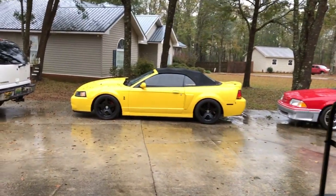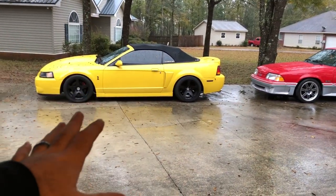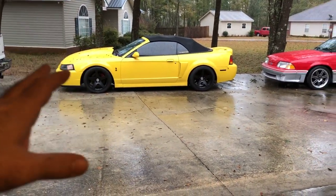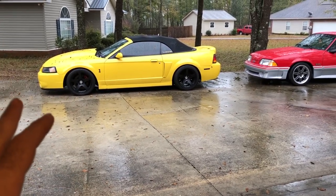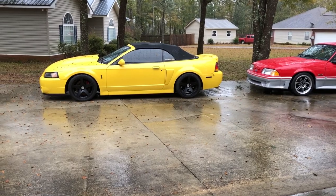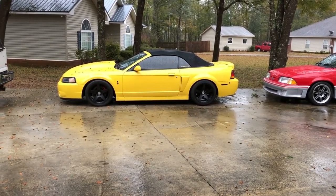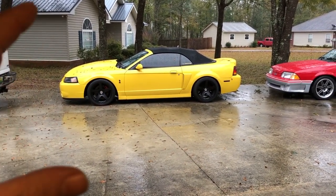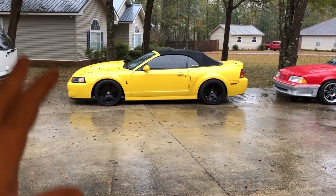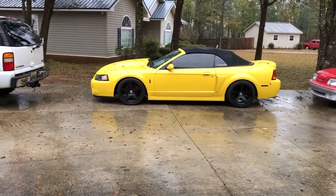We have been pretty much nonstop Fox body content. I still own a Cobra, and there's a good chance this car may find a new home — I'm not sure yet. I do read the comments. The car is not really broken — it needs a new tune for me to be happy with it, and the transmission is making a whining noise which I'm almost 100% sure is a throwout bearing. Once we start doing the tune and all that, I will go in and put a new throwout bearing in the car.